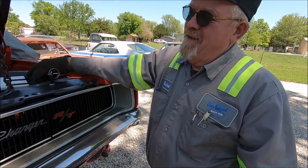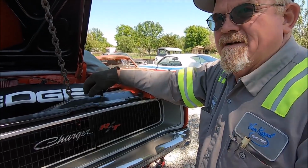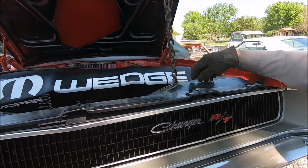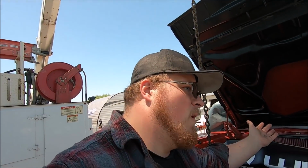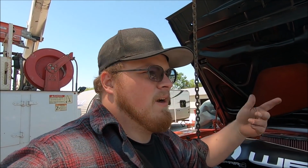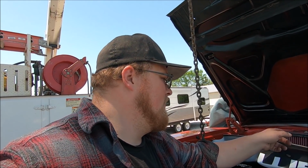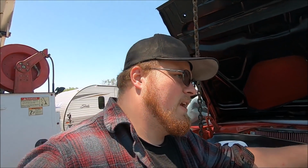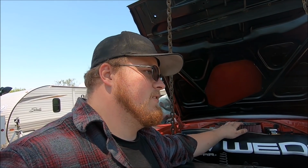Ain't a Hemi kind of a wedge? Well, the Hemi's basically a 440 block, architecture-wise. Yeah, but the block's reworked for the Hemi heads and everything. Technically, the first gen Hemi shares more in common with a small block Chrysler, and I need to do a video on that, showing off the 241 and a 340 block or 273 block. Whereas the Gen 2s take more from the big blocks. Yeah, the Gen 1 Hemi became the small block, whereas the RB block became the Hemi block in the Gen 2 series.